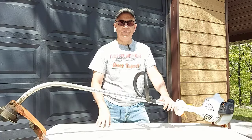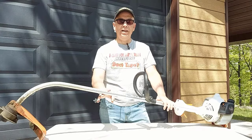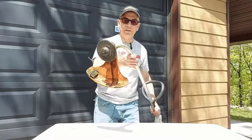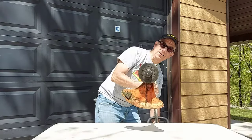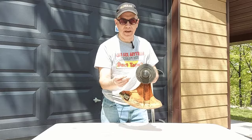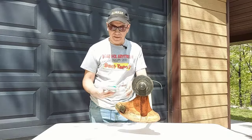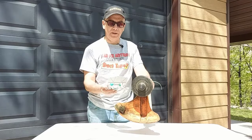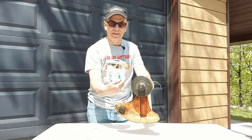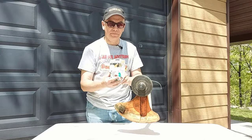Hello, welcome to Getting It Done North of Seven. Today we're going to talk about lawn trimmers and I'm going to explain to you why your string trimmer line won't feed. The very first thing I'm going to talk about is maybe you got the wrong string size — it's got to be the right diameter thickness. With this lawn trimmer, it's a Stihl FS38 and it requires a two millimeter or 0.08 of an inch thickness of line. I just keep to the recommended thickness of line.